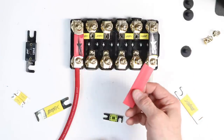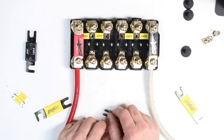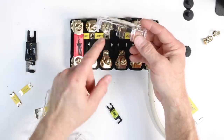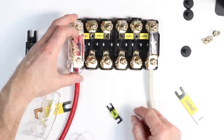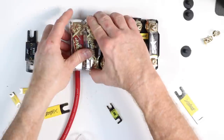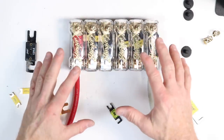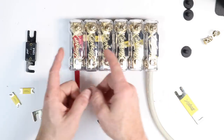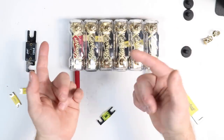We'll do the same with the small end caps to build this out visually before putting it in the car. When done, the covers snap right over — they have grooves that clear the bus bars, so they all snap on in the same direction. We'll end up with a nice Stinger fuse cover, and all we'll have to do is pull off the two we want when swapping amplifiers. We can see power and ground clearly, so let's get the heat shrink on and get this wired in.